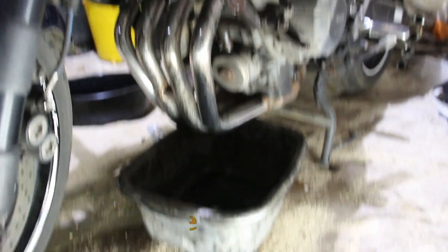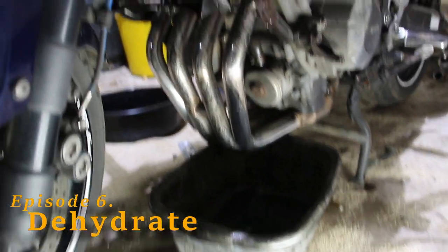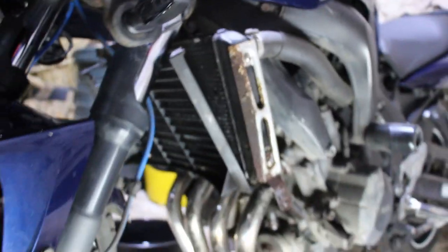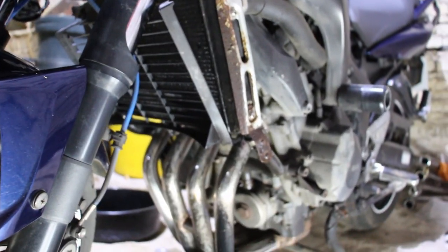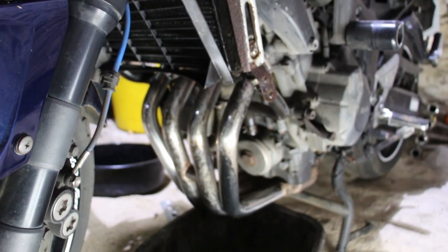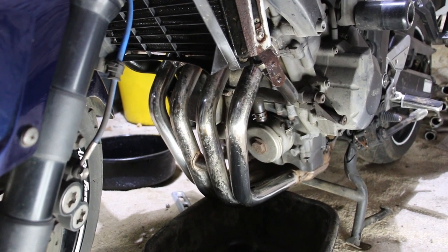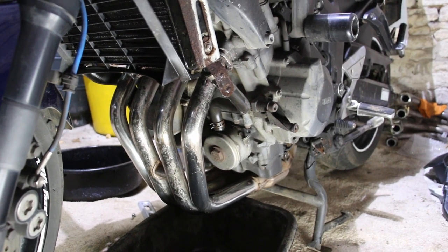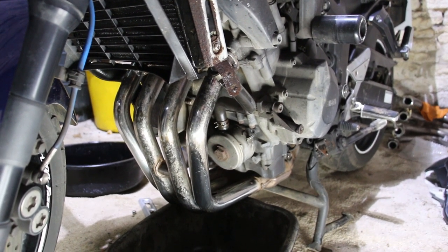So while she's a little bit incapacitated, I thought we'd get the buckets out. Might as well drain her of coolant. Going by how wet the radiator still all is, I reckon it was leaking from multiple places, so not ideal. So we have a new radiator, so let's drain the coolant and while we're at it we'll drain the oil as well, and we can just let it sit there for ages and get every little last drop out hopefully.